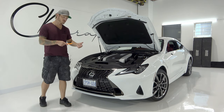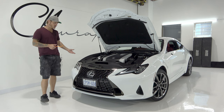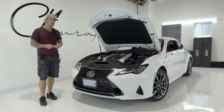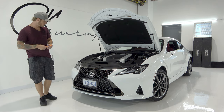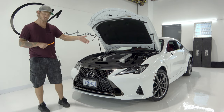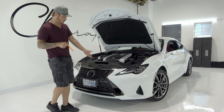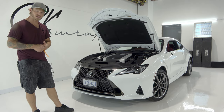I'm going to show you where the screws are on the bottom - the ones you have to unscrew - and basically just do those without the camera being there, but I want to show you where they are. I'm going to show you the wheel well area, give you great detail as far as the video goes, and make sure you see pretty much every clip and screw. I have the wheel cut to the passenger side, so I have access to the clips in the wheel well area. There's a couple of clips there - that's what we need the flathead screwdriver for. The 10 millimeter socket is more for the screws along the bottom. Across the top here, we just have regular standard clips.